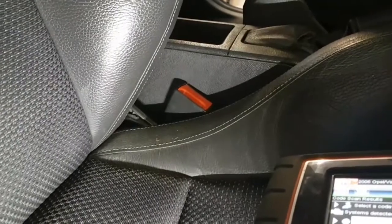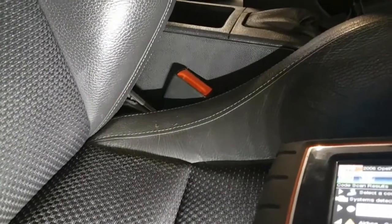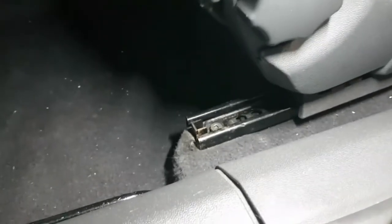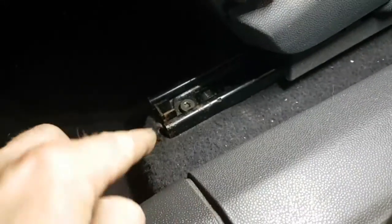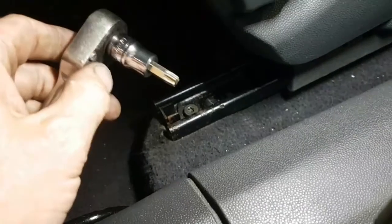This car has had a slight front bump, so we've already replaced the front impact sensor, which I've shown in another video. We're now going to go ahead and replace the pretensioners on these seats. Slide the seat forward and you'll reveal a T40 bolt, so you're going to need a T40 bit and a ratchet.